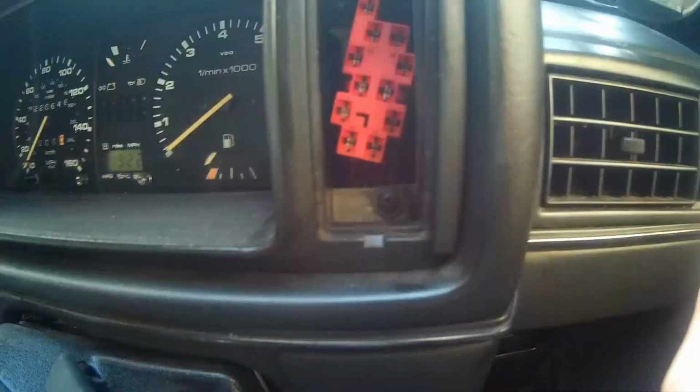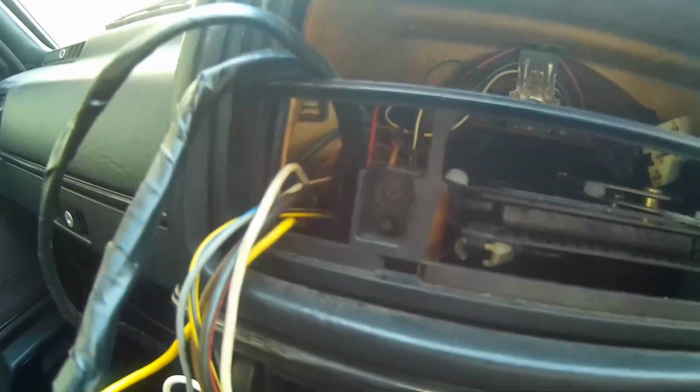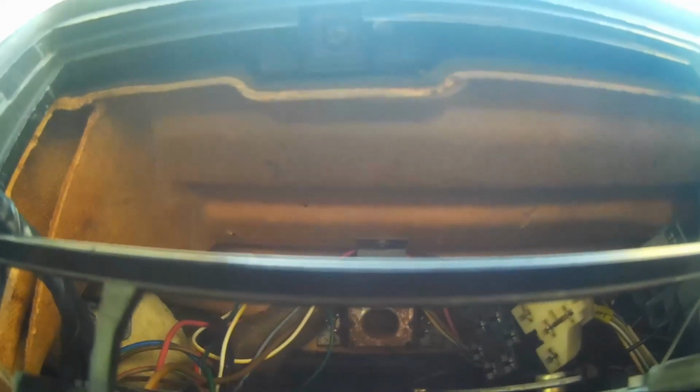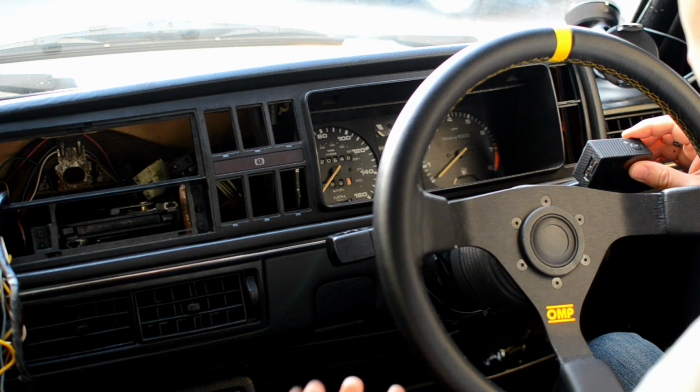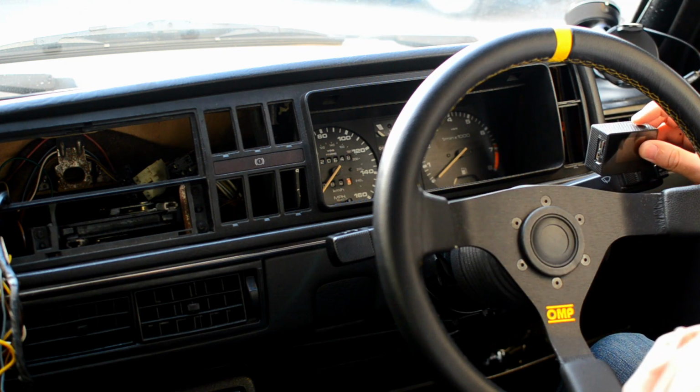And then what you can see is what we've revealed now is we've got a screw there, two screws there, and a fourth screw there. We also have, harder to see, but we do have them, a screw up the top there, and then one at the top of the instrument cluster above it, and then one there as well. Now the instrument cluster itself does have some screws. Again, not a big deal, and we'll show you those when we get to them.